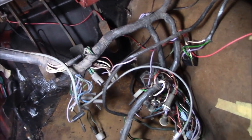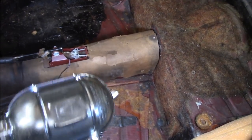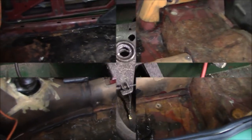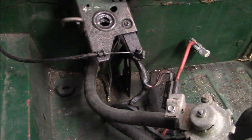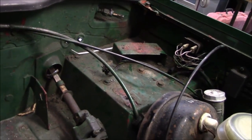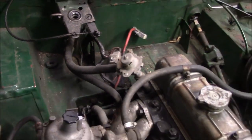We're going to move on to taking stuff off this car now that we've got it cleaned up. Les is going to work on removing the cardboard transmission tunnel piece. I'm going to start working on removing the handbrake and the handbrake cables, which have to be pushed back through to get the body off. I'm just about to take the bonnet release off — I'll show you quickly how the stock setup works. There's a stock cable location running along the back of the bulkhead, with a little trunnion and a stop screw on the end as a safety.